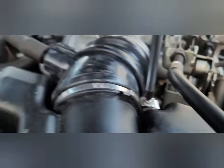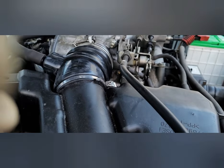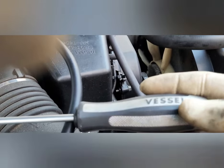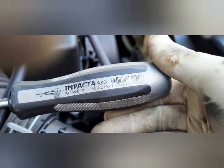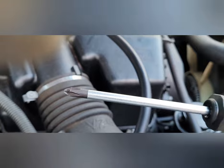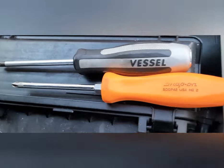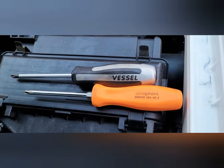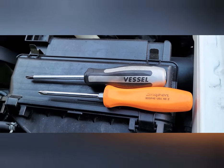It's just obvious, and a lot of people don't know that. If you're working on a carburetor bowl on a Honda Mikuni carburetor, every one of those things are stripped out especially the older ones, and this screwdriver right here will bring it right out. That's the Vessel Impacta 980 — there are different sizes, number one, two, and three. I'll put a link down below. There's definitely 100% difference between American Phillips number two and a Japanese Industrial Standard. Have a great day guys, appreciate you watching.